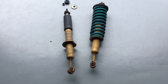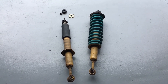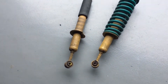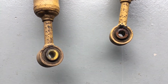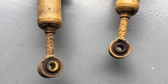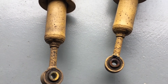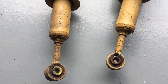This is what happens over time. These are quite a few years old — I reckon about three or four years. So all the weight of the vehicle is on this bottom bush. Most brands chop out in the end. We do find the Dobinsons ones to be really good and last the best, along with the OEM ones. These are Monroe ones. We do like Monroe as a brand, but we don't currently use those setups in any vehicles.